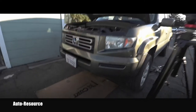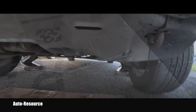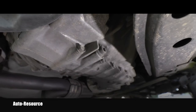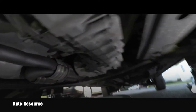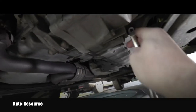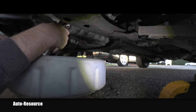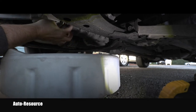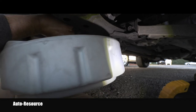I can go underneath the car and drain the transmission. There's plenty of space underneath the front of the car. I raised it a little bit for myself to get there easily with the camera. I'll use this small 3/8 breaker bar to release the drain bolt. Here is the location of the bolt — I put a light here so you can see where it is. You just put that breaker bar inside the bolt and release it turning it counterclockwise. After loosening it, I have my catching pan ready. Now removing that bolt, also including the crush washer underneath it, which I will be replacing later.